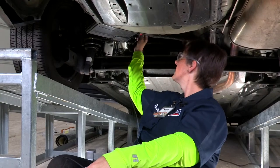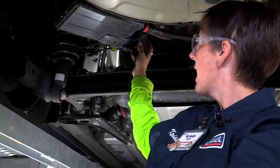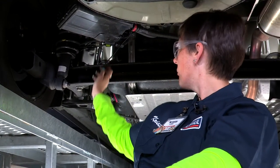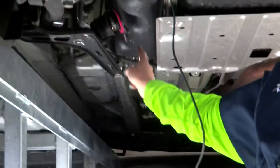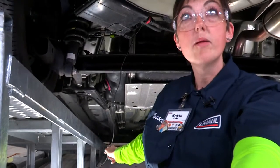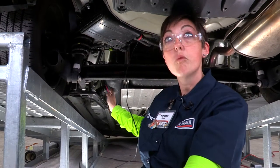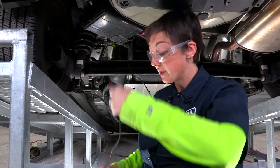As you can see, we came out right here in the trunk, which we determined was the best spot available — it worked out perfectly as we are right here beside these wiring harnesses. Our brake lines are going to run all the way down the vehicle. This is going to be the safest way to route this power wire, because we have to get it all the way up to the firewall by the brake reservoir. We're going to route this down through here.